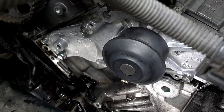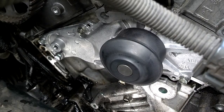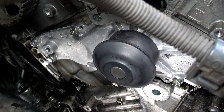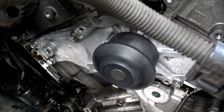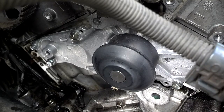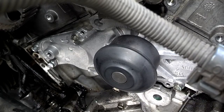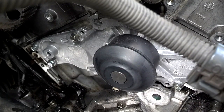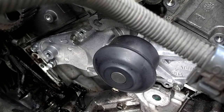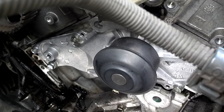I did my parts comparison and I'm going to install the water pump first. I got the water pump in place, cleaned off the surface, and lubricated the seal with some coolant just to get it wet. The water pump has alignment pins on the back. Start all five bolts by hand, get them lined up, then snug the bolts down one at a time — top, bottom, left, right, back to left. Then snug them more to pull the pump in tight, then tighten in the same star pattern.